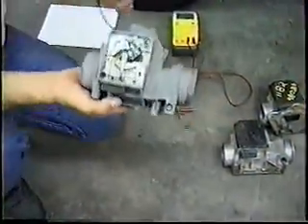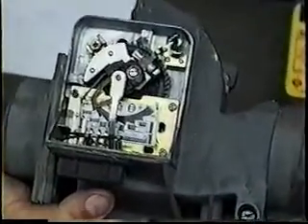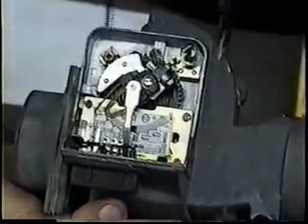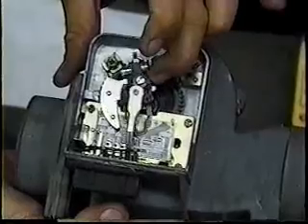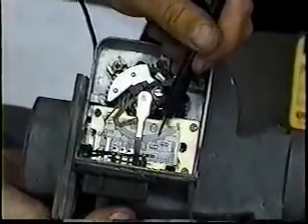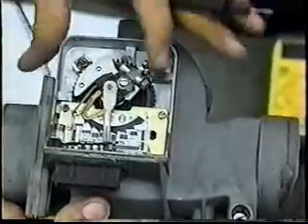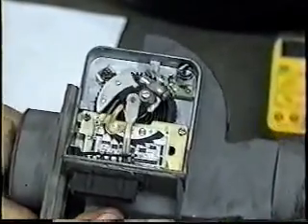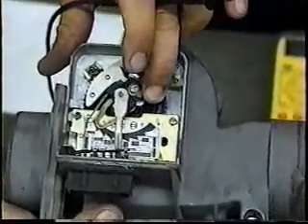This is an early style air flow meter with the top cover — the black box cover — taken off. The only servicing that can be done to these is there is a printed circuit on either side, and you have a wiper strip that runs across it. It has two very sensitive small copper contacts which wipe across a carbon board and make contact with the other wires. This approximates air flow — the further the flap goes, the richer the mixture injected, and the longer the pulse width time of the injector.